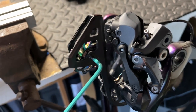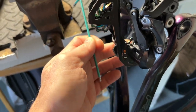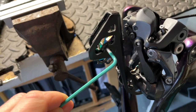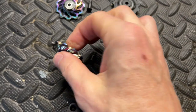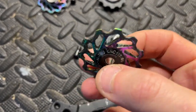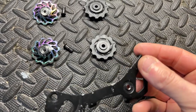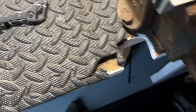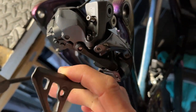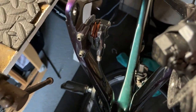To change these out it's really simple. It's just a 3mm Allen key on the top one — it's on the inside. So we'll just take these off. That's both of the original pulley wheels off. These are just metal ones that I got from AliExpress. What you'll find is when you've taken both the jockey wheels off, the inside cage will probably come off as well. So if we go back to the bike, the outside cage is there but the inside bit is missing.